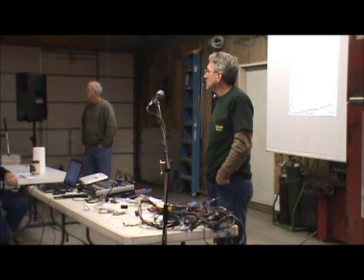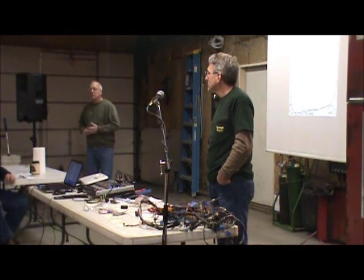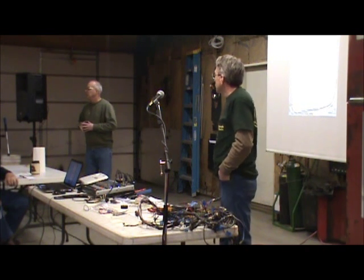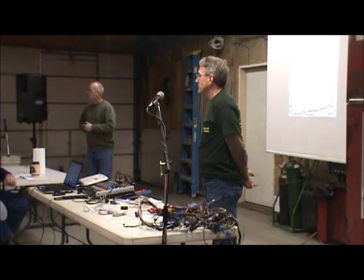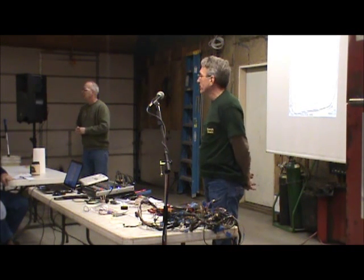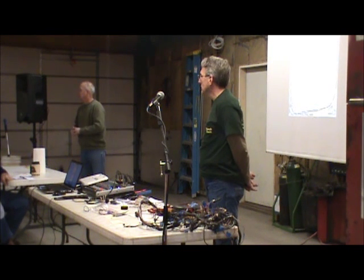For the conversions that we sell here, what size is that? That's a 65. There you go, there's your answer. That's just a regular Delco, a knockoff of a Delco 70s style single wire alternator. At 65 amps, you're still able to maintain the original harness's integrity. Unless you really stress it out, it's not pushing 65 amps all the time. You only get that kind of surge momentarily. You have to really push things a lot, but you can put that alternator on your car. We put them on TR4s and TR3s with no adverse effect.